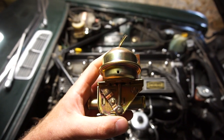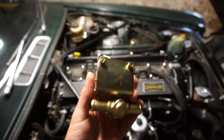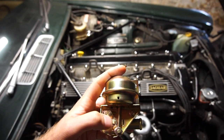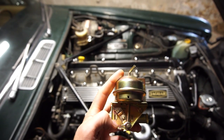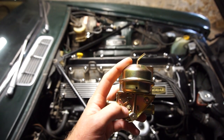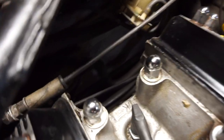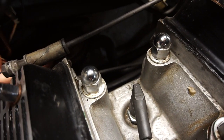Here's a closer look at what a heater valve looks like on a Series 2 XJ6, XJ12, Series 3, or XJS V12. They sit mounted up in the bulkhead. The top part is the vacuum operator - when you apply vacuum it pulls up and closes the valve, so it's normally open. Mine is leaking right here, dripping down there. It's a very common place for them to leak - usually they get a little stuck and when you try to free them up they start leaking.